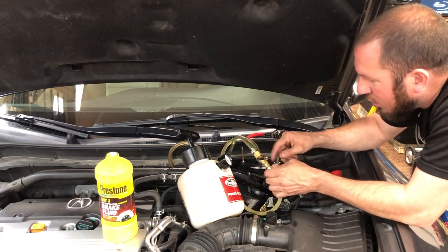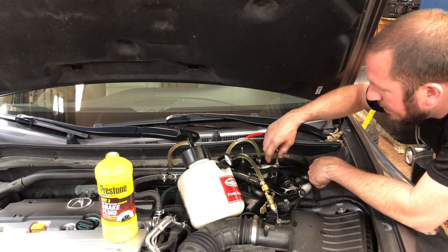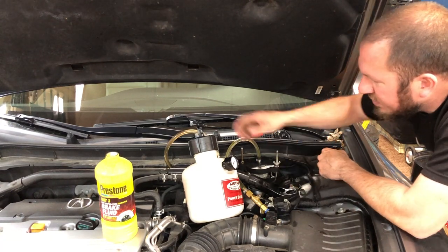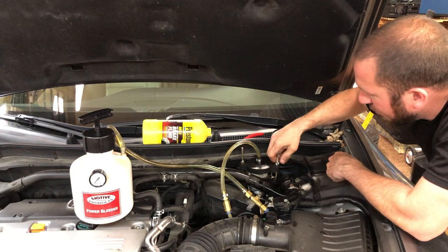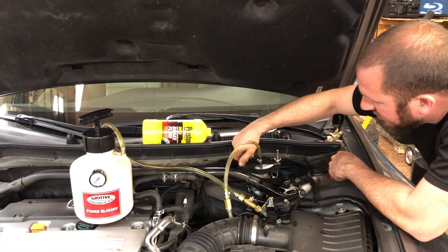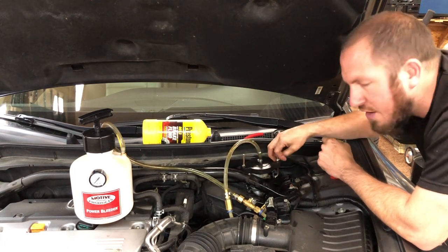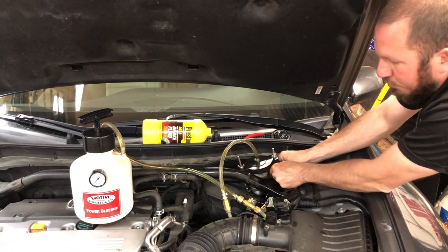When disconnecting it after getting all the air bled out, go ahead and shut off the valve. This is the only part that makes a little bit of a mess — when you release the pressure. Sometimes I leave it open and release the pressure on this side so most of the brake fluid comes back; other times I shut the valve then remove the adapter. Either way, it may leave a little mess by the master cylinder. Always keep Vaseline or grease on hand because that seal doesn't work well with just rubber alone — always use Vaseline to make a proper seal when it's plastic to plastic.